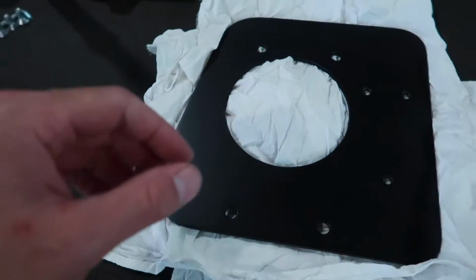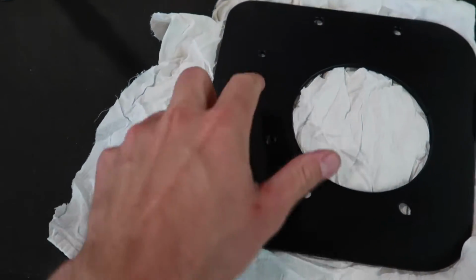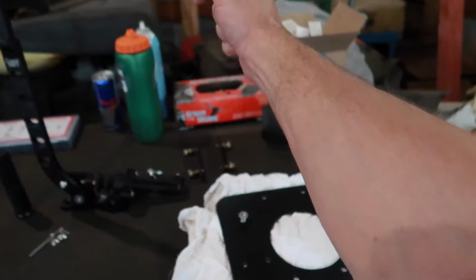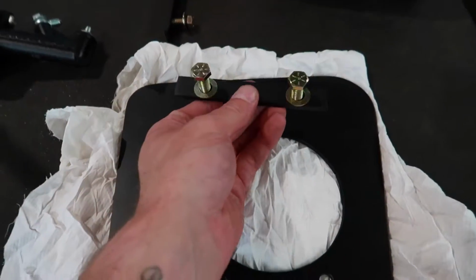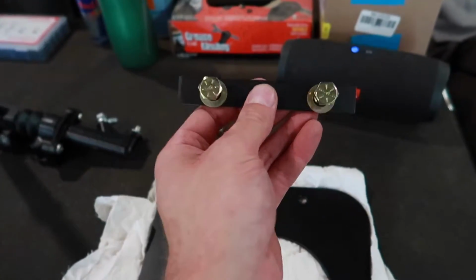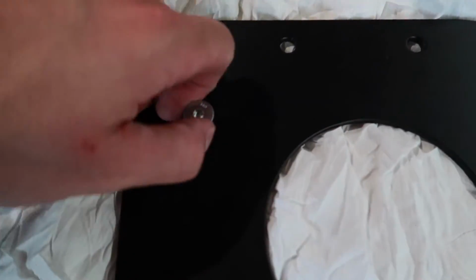And then this is the bracket that Matt made for us. Super cool. It's gonna go like that in the car. So he drilled and tapped some nice mounting holes for these bolts to mount the handle right here. So the handle's gonna sit up like this, boom, boom. It's gonna be super cool. And then we got these nice holes already pre-drilled for these brackets that go underneath the tunnel. We thought that if we put brackets underneath the tunnel, it would allow a little more support to not pull on the sheet metal around the tunnel. Apparently that sheet metal is pretty thin, so it can be pretty brittle.